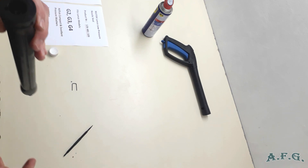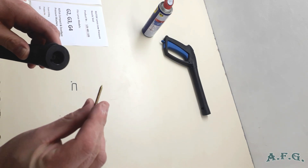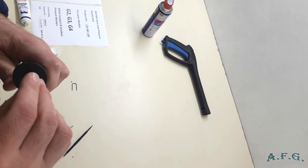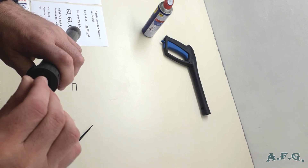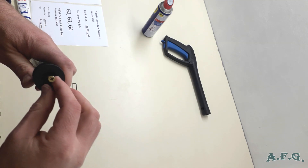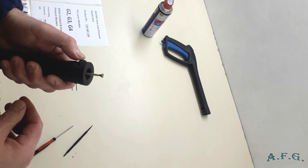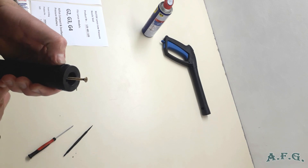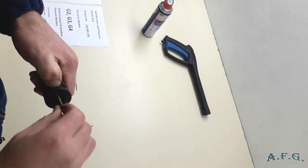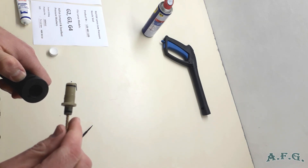The next step is to take this 4 cm wood screw and screw it a little bit inside. Don't damage the nozzle. Before you start to pull out, you have to press this button as far down as possible, and then you can pull out the low-pressure nozzle seal.